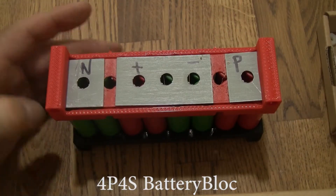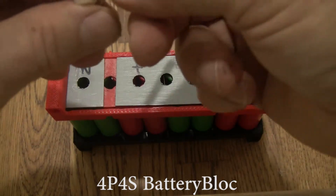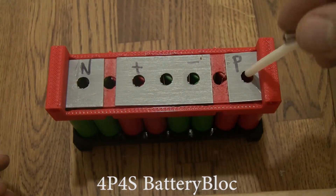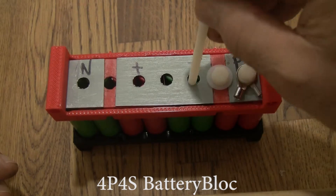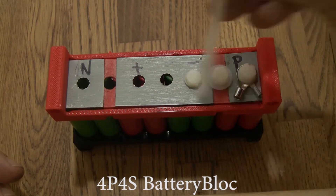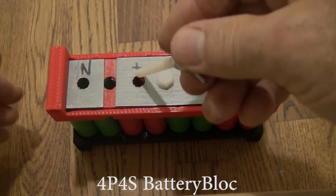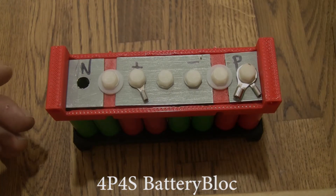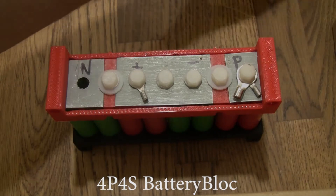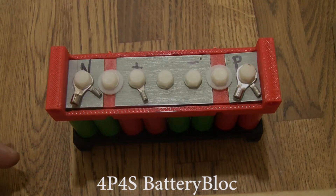Because we need to put a power terminal — one of these big guys — and a sensor terminal over here on the positive of the battery. And then we're going to span this gap, and we'll use a wide washer for that. This is the negative terminal — it does not get any connectors. These two are positive, so this one does get a terminal on it. We use this wide washer here for gap spanning. The negative terminal of the battery will always have a wire and a power lead coming off it.